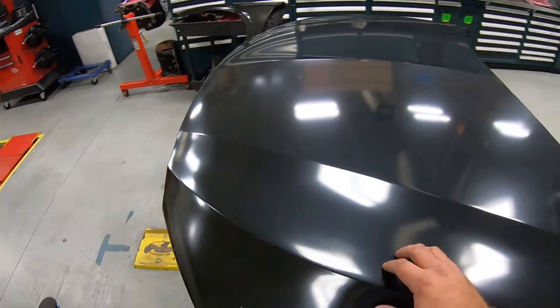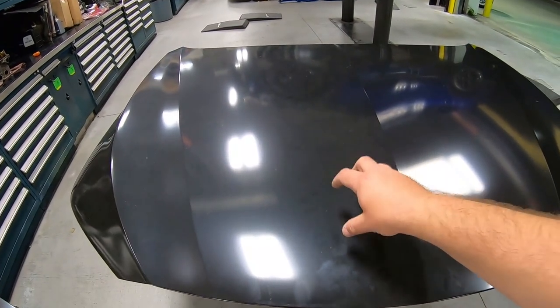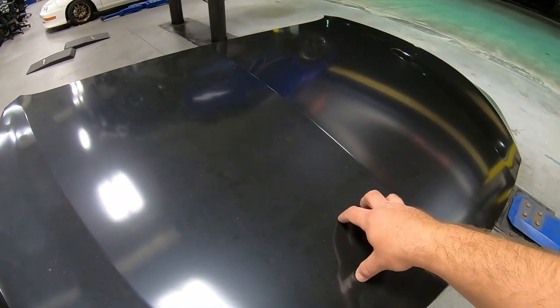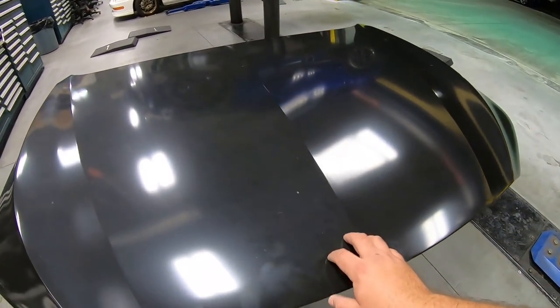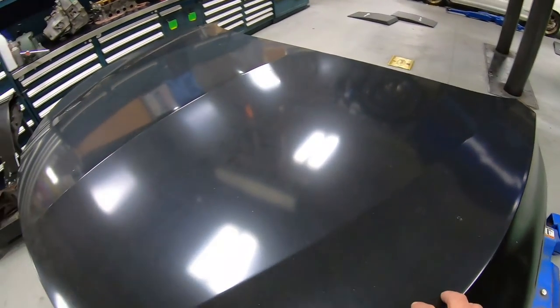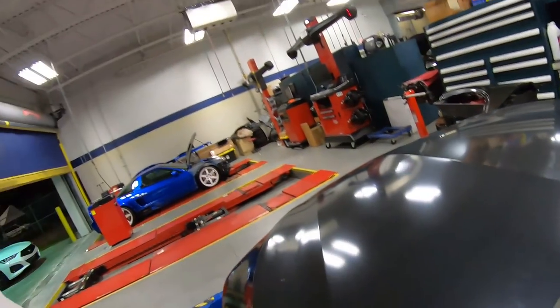Let's chat about a new part. This is a new OEM part, and what we see here is a black primer from Honda. I'm going to show you how to prepare something just like this — OEM or aftermarket, it's going to be similar. Although if you get aftermarket parts, the primer that comes on them is not good. I know a lot of guys that will have problems — even with CAPA-certified parts — when you go to put the paint down, it just eats it up. It wrinkles it alive. So you never really win on the aftermarket parts.